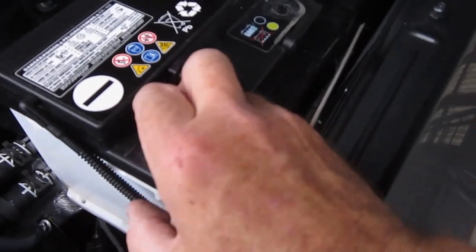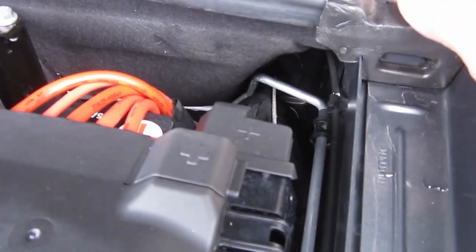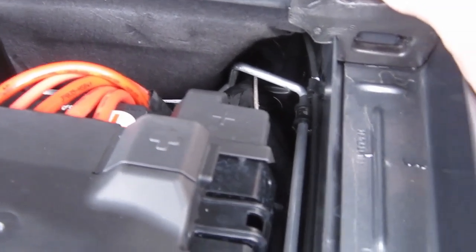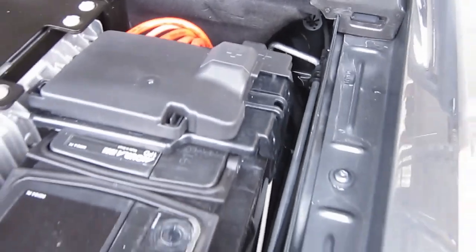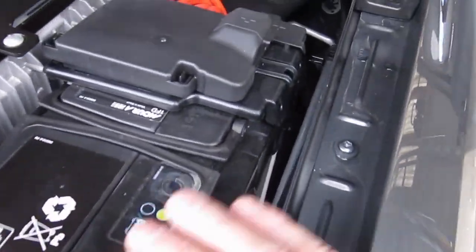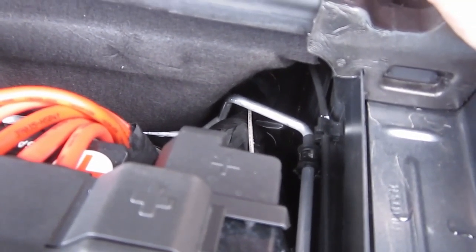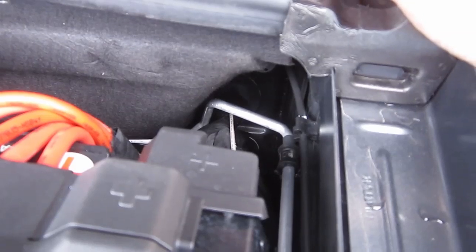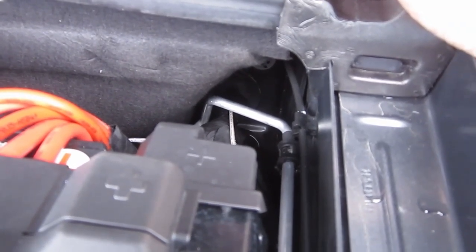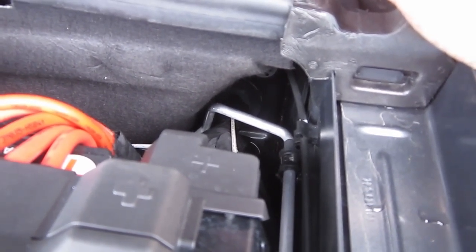The best thing to do, if you're unaware of that, is to disconnect the negative terminal of the battery. But then you've got all sorts of other issues — probably error codes and security codes for the stereo and other things. So unless you know what you're doing, talk to the dealer about disconnecting the battery at that terminal. Now, when passing cables through a rubber grommet, a lot of installers will arbitrarily bang a hole in it or cut a slit in it.